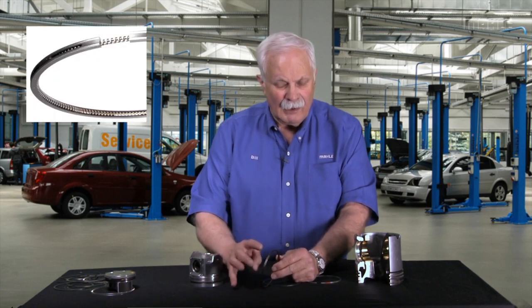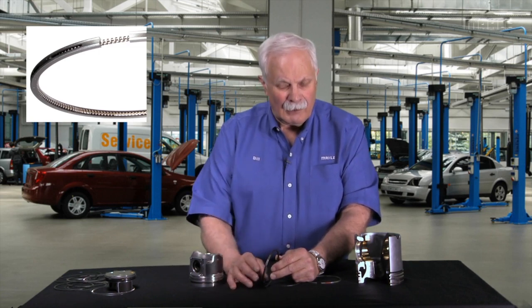Now let's look at the differences. I should remind you: when I'm talking diesel engines, I'm talking engines that we expect to run from 500,000 to a million miles before they wear out. So we tend to spend a little more on the ring pack because we're expecting much longer life. Number one difference is in the oil ring. The oil ring I showed you on the light-duty was three-piece design. This is what we call in the industry a two-piece design — either a piece of steel or cast iron formed in one piece with slots in it, and then behind that we have a coiled spring expander. It's actually that coiled spring expander that puts the tension out on the cylinder wall for this ring to seal and scrape oil. It's an excellent design.